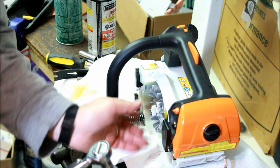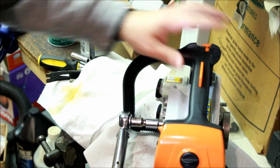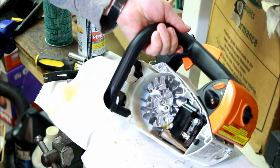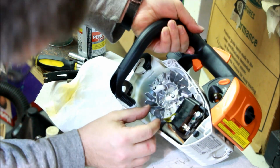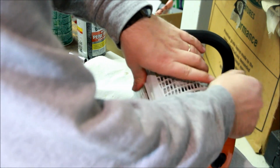I'm going to go back around here. I think even 10 foot-pounds is going to be a little too much. Like 8 foot-pounds here. That should be plenty. Has to be blue Loctite on there, otherwise you're in trouble. Okay. No gap issue. Starter cover goes back on.